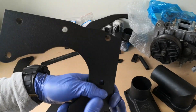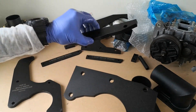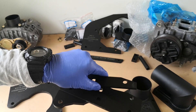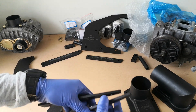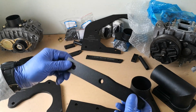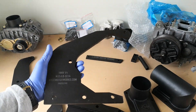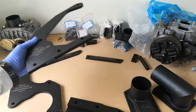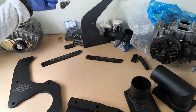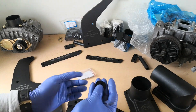This bracket is meant to be mounted just around the alternator — one here, one here, one here — it clears the alternator, and then we have these spacers that'll be going on top. In the next final iteration, however, we'll be making the spacers one whole 10 millimeters instead of currently being five millimeters each. And then we have the final mount for the SC14 which goes on top, and we require some reverse-threaded nuts. Of course, to space out our tensioner pulley, we will be requiring these spacers as well.